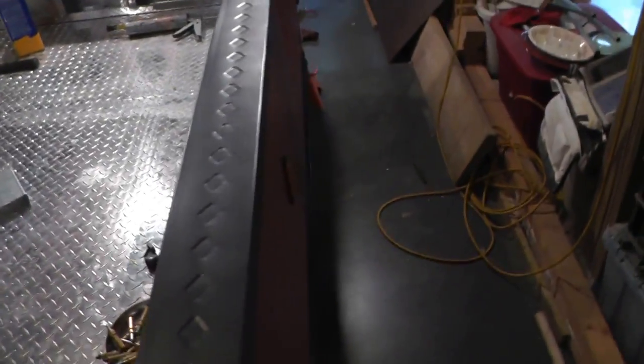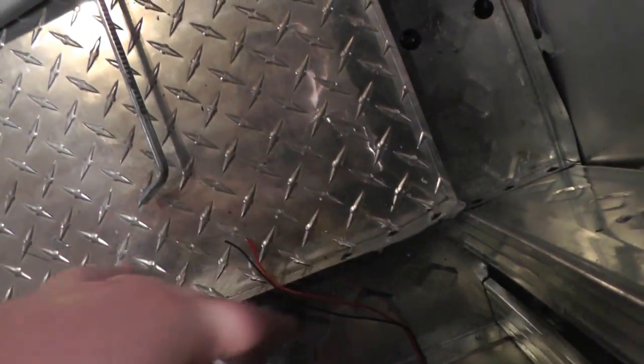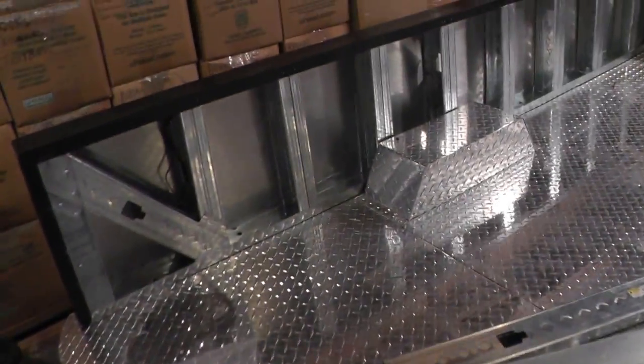You can see the lights — we added our back marker light to mark the back of the trailer. The one in the middle is actually going to be a turn signal, which is really great. In the front, we also have a front marker light right here — you can see they come through the holes. We're going to attach a connector to each so we can unplug them — if the light ever dies, we can simply unplug it, cut the connector off, and add a new light. This type of connector you just cut in half and you can use it just fine. Same thing on the other side.